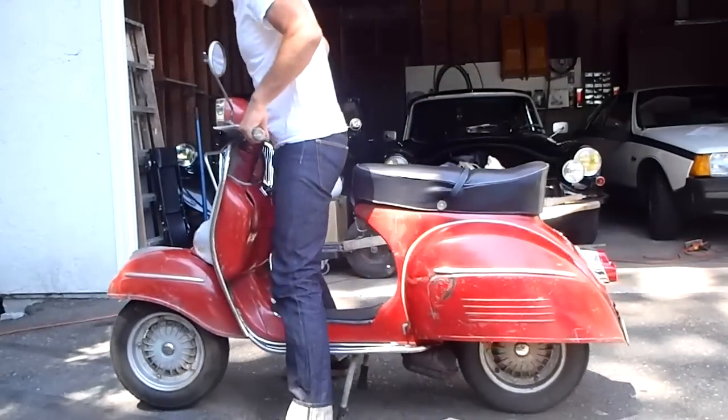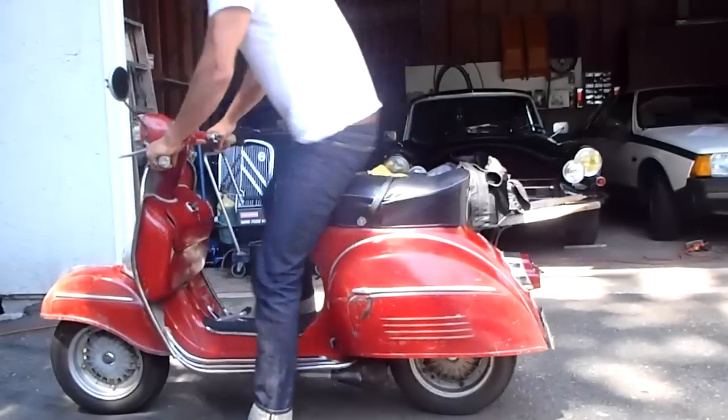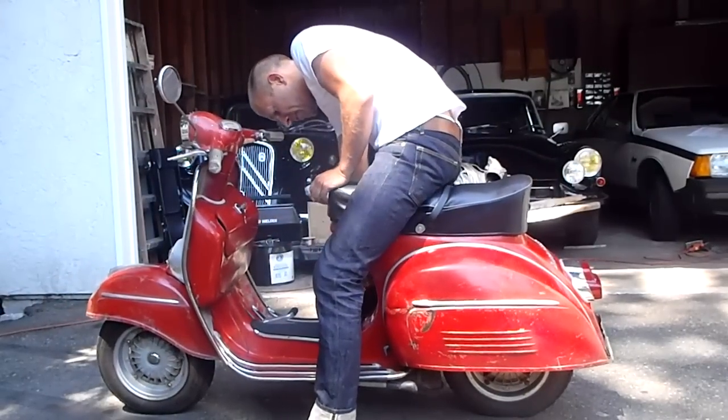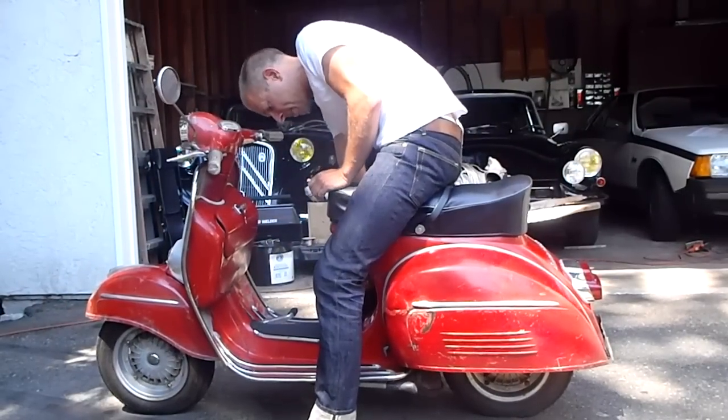In the morning it's going to be pretty smoky. Running dyno oil in there right now at 5%, just trying to bed the new rings in. Normally I'd run synthetic, but not doing that.